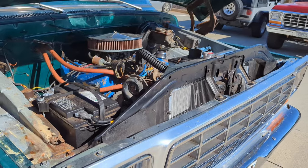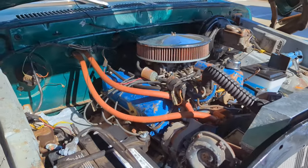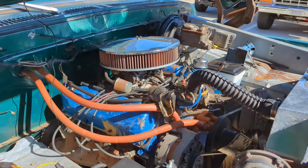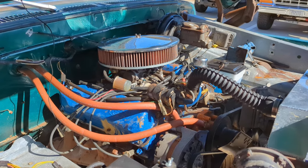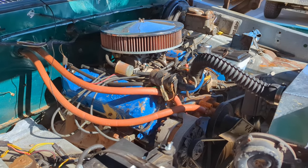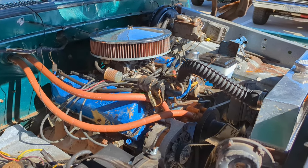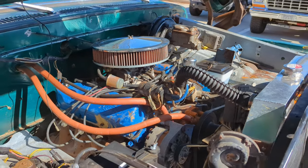You may be wondering why the 10-speed — it is big, it's hard to fit. The reason is because it comes with the Ford Motorsport control pack and the Ford Motorsport calibration for both the engine and trans. In terms of starting and driving and overall drivability of the engine — excellent. Calibration of the transmission — excellent. It makes this thing a much more pleasant machine than piecing together various parts. We're excited to try this route. We're going to see what the engine position needs to be, the sheet metal effect, et cetera, in some later videos, but I'm pretty confident we can work our way through that without too much trouble.